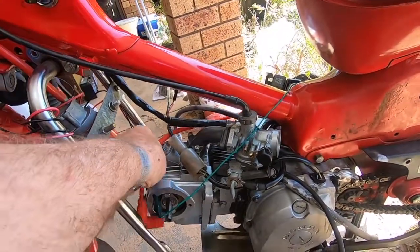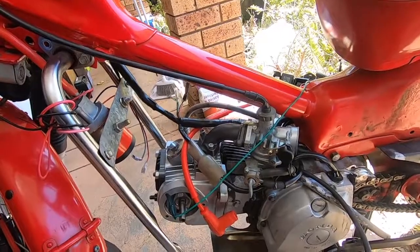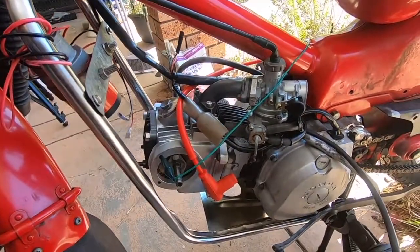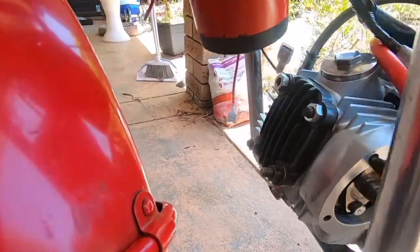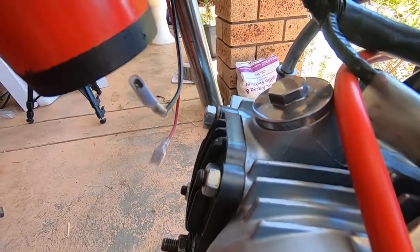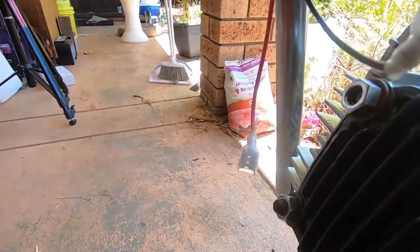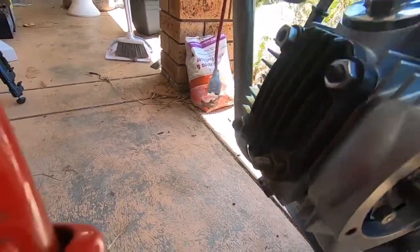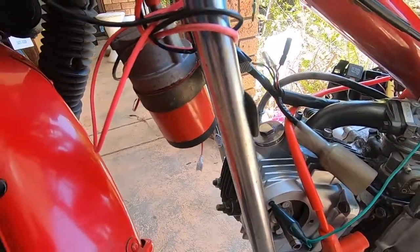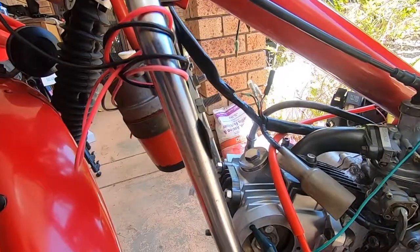And then because I didn't really know the gentleman who owned the bike and know his workmanship, and because I was a little bit suspicious, because when I looked at the head studs, I don't know if you can see, one of them is protruding out far too far, which may be that it's starting to pull out of the crankcase or unscrewing from the crankcase, and this top one isn't sticking out far enough. So there's something weird going on there. I checked the timing, the valve timing, and it's all right.